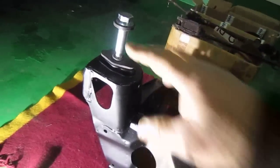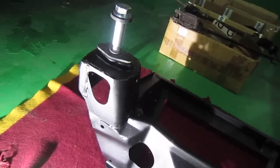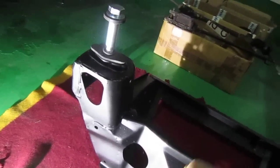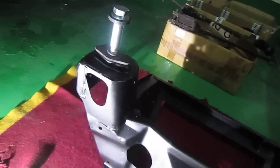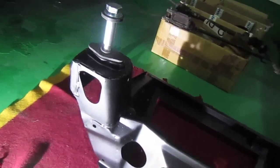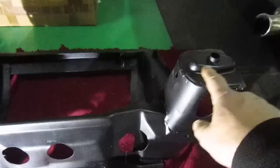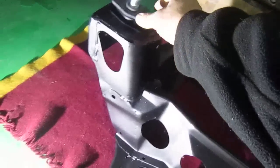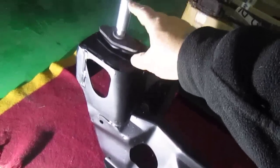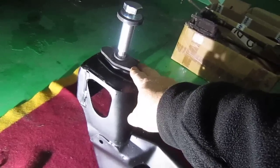Without the rubber, and using an alloy washer here, he says the steering is as direct as it was when the Mini first came out — absolutely precise, with a little turn of the wheel and you're moving. Apparently with the rubber you get a lot of side movement, rocking backwards and forwards. So I'm going to give it a go — I'm going to go without them. He just uses aluminium and nothing in the rubber position. It's entirely up to you.